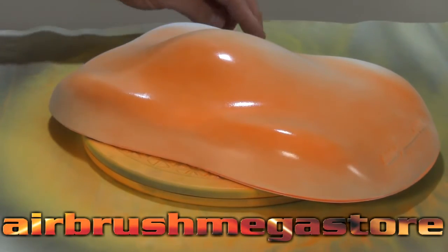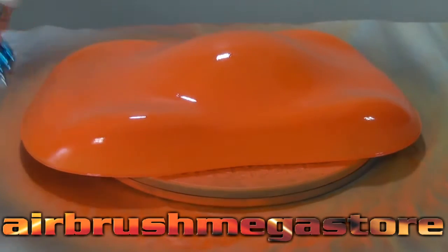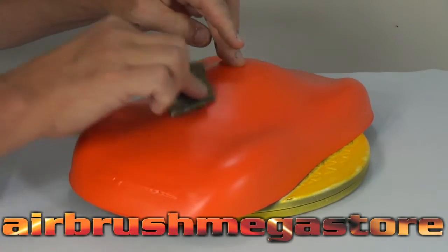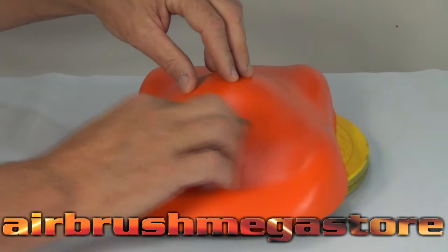Using a mini spray gun at 1.2 mil, put a couple of guide coats down, then hit it with a couple of medium wet coats, drying in between coats using just the compressed air from the spray gun. If you've got anything that's landed in the product — a hair or something — you can color sand it out using wet and dry; just use it dry to color sand out any imperfections, including runs.